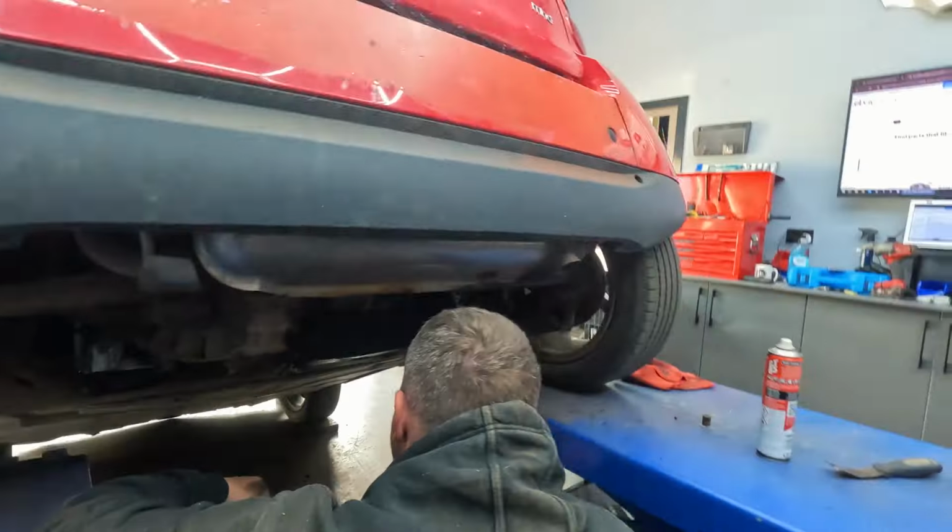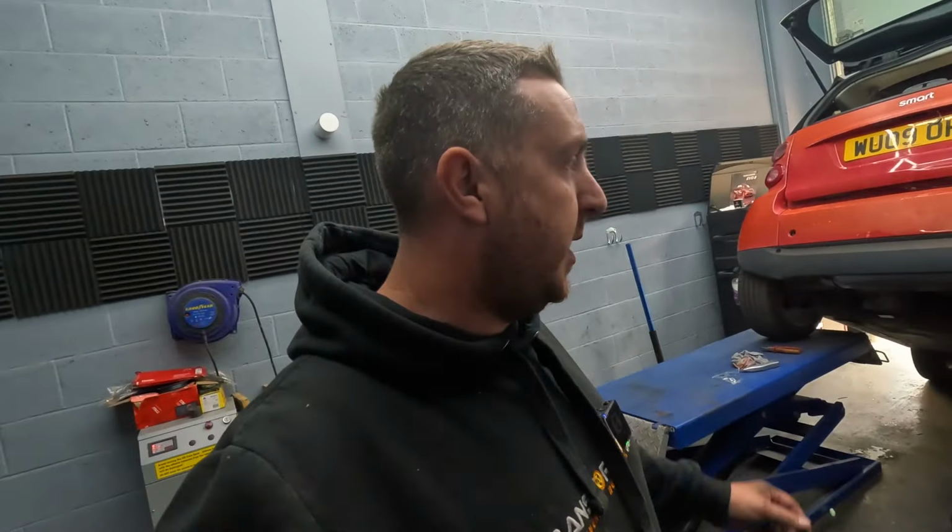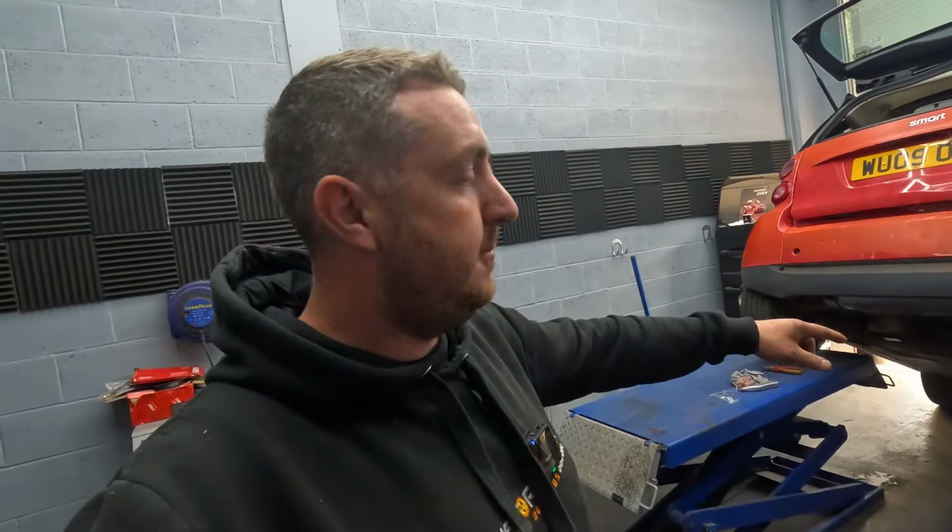Yeah, that's just a noise in the gearbox that you can hear. There's no metallic bang there, anyway. Right, so after getting the bar on the end of the crank and moving it about, there's not any noticeable play. It feels quite silky smooth, to be honest.